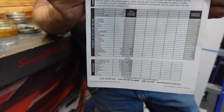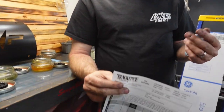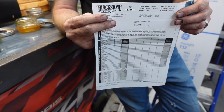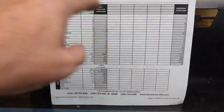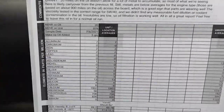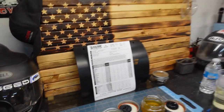This is the report. If you know how to read this report, feel free. Here's the thing — there was only about 20 miles on the oil, because it was just roughly what we did in Pismo. But still, give it a chance — if it were really bad, there would still be metal in it. No metal in the oil. It looks like his car is cleared. The report — I read that — seems to indicate there's no problem with the motor. It's showing clearance, within their specs.